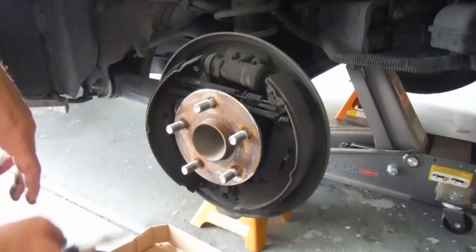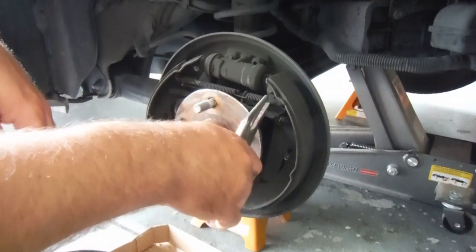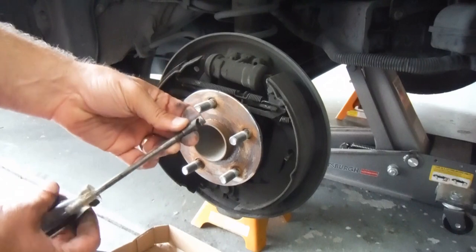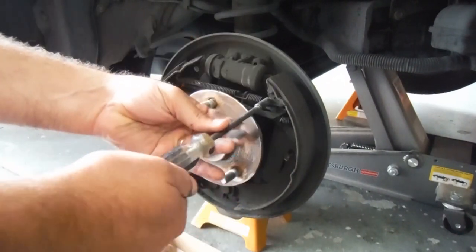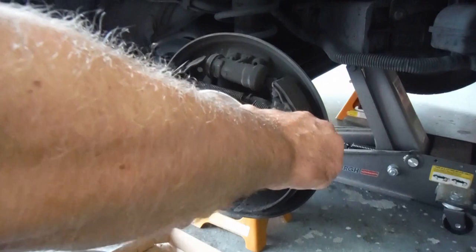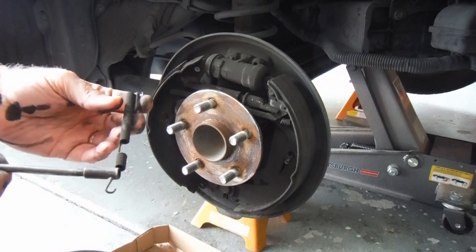You can use some diagonals which grab pretty nicely to these springs, or some needle nose vise grips — those will work out just fine too. If you've seen some of my other brake videos, I like to use this little tool which has a little notch in the end piece with a threaded rod. When you turn that, it clamps down on that spring pretty nicely, giving you a bit more leverage when pulling those springs. So you just pull that back and off. You can see it has a little cam piece that goes on that end, so we'll keep track of that.